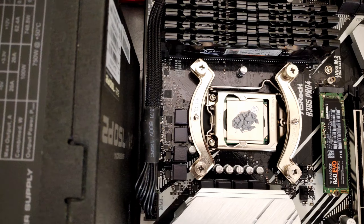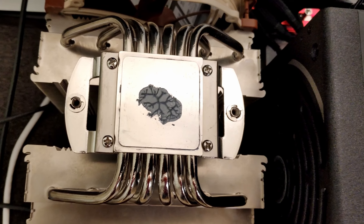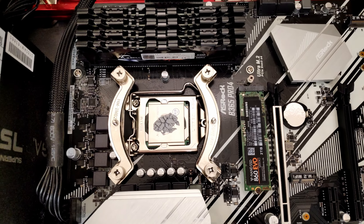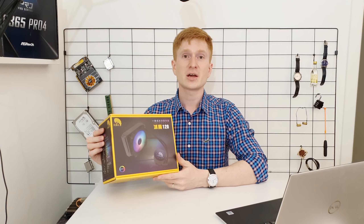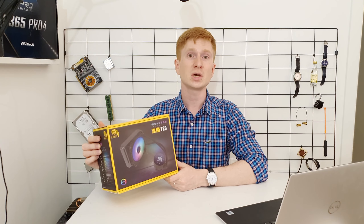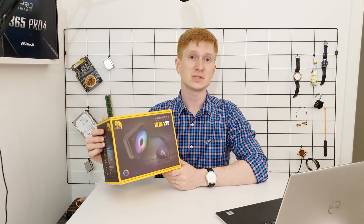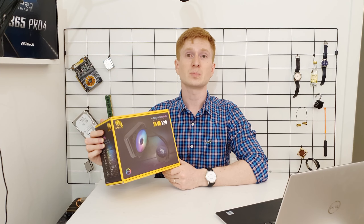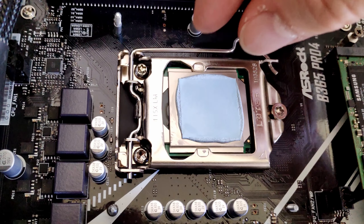After investigating, I figured out that the IHS on this mutant is simply not high enough to make proper contact between the CPU and the cooler. After a few days of struggling, I came to a solution. I had bought an entire box of coolers and a few other models in bulk from China. The solution was one of those coolers — if interested, I'll make a dedicated video about them.